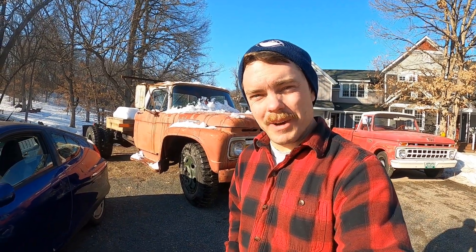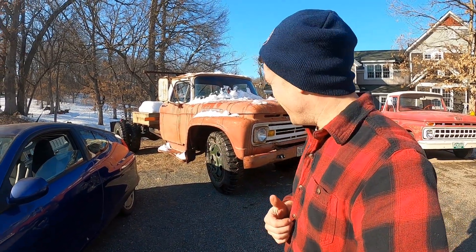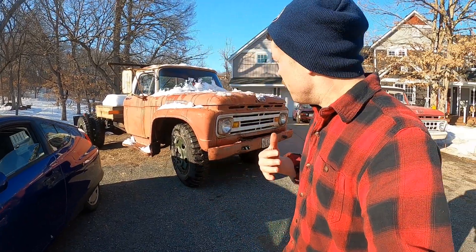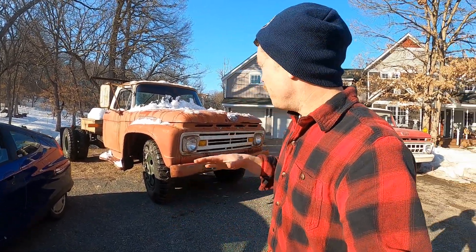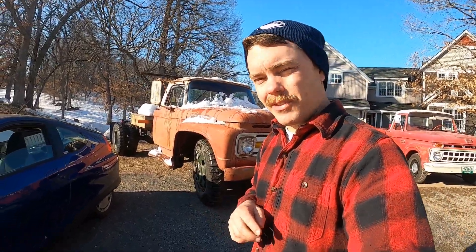The other cars have issues, but Mouse takes the cake for that. There are no rear brakes — I have it capped off but it stops fine going forward. It's just manual brakes and no rear. The whole cab needs to be replaced — it is rusted out. I wish I could save it but it is just gone. There are no cab mounts in the front; literally the place they would mount is even gone. It would take probably five times more money to repair the cab than to just get a different cab, so we're gonna try to get a different '61 to '63 cab.